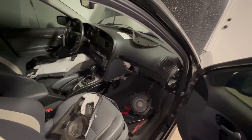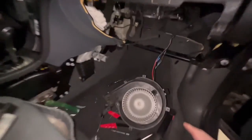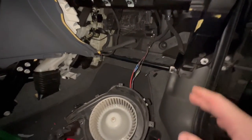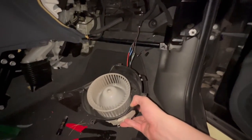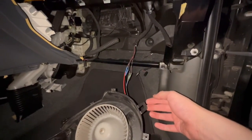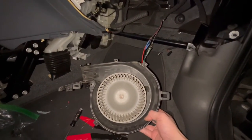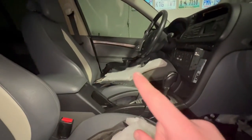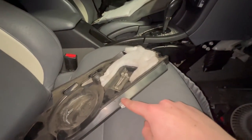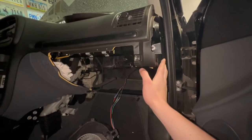I'm going to end the video there — the car is a complete mess torn apart, but for reassembly, if you're not dealing with a problem like this: first put your new blower motor back up into the casing using the helpful clips to guide and clip it into place first, then reinsert all seven bolts. After that, do your footwell ducting, footwell kick panel, side panel, and lastly the glove box.